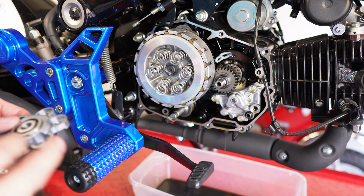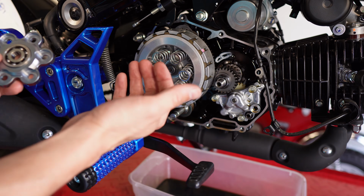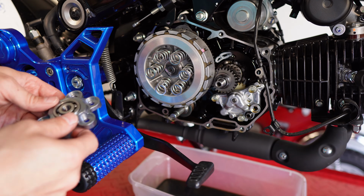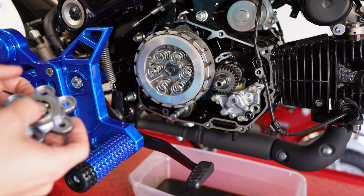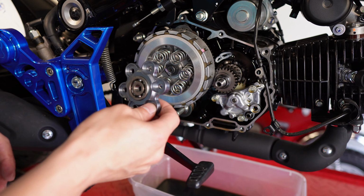And then taking the new lifter plate. This is a 6-hole lifter plate, so if you want to modify the basket so that you can use 6 bolts instead of 3, you can. I've honestly found on all of my bikes just using the 3 seems to hold just fine. I've never had one break. If I ever do, I may switch to the 6-bolt method, but for now I'm good just using the 3 stock bolt holes.